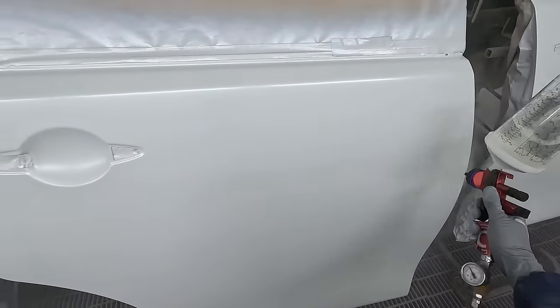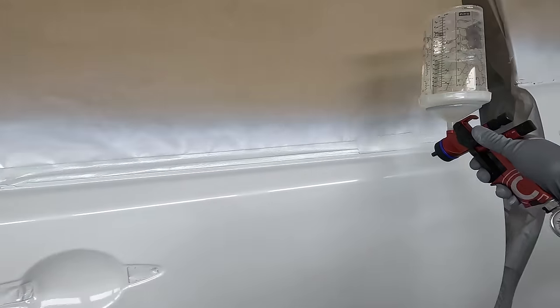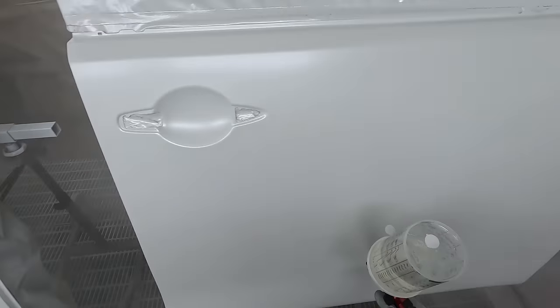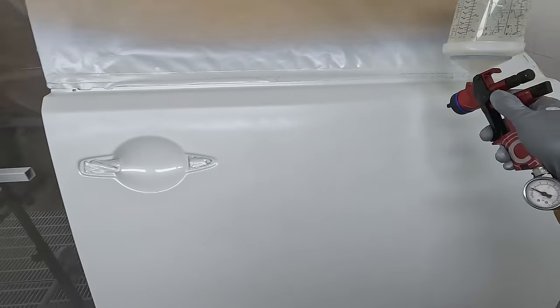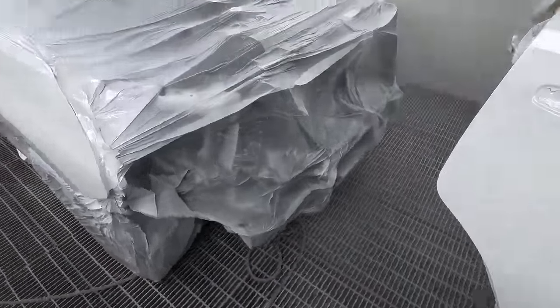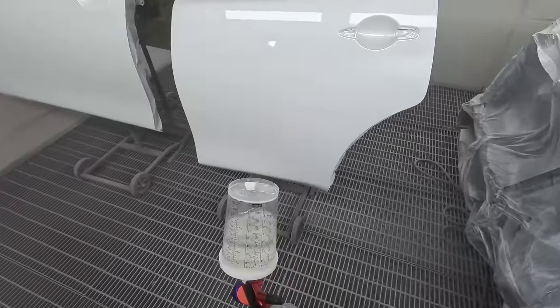It's been a big day on this one. I tried this last night with the etch primer — what I like to do is get them into etch primer as soon as I can, which sort of stops the rust. But if you don't have enough time to clean and paint them in one day, I'll just clean it to bare metal and that gives me the whole day to paint it the next day. It's been the best part of the day today just to get this one done — it'll be rolling around to 4:30 just as I'll be cleaning my gun out.